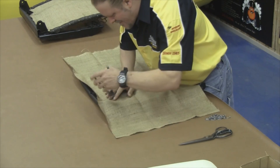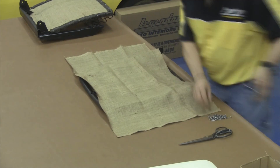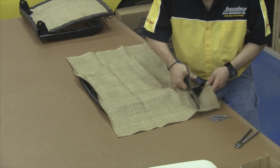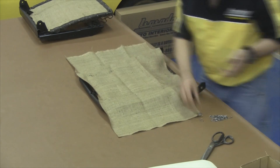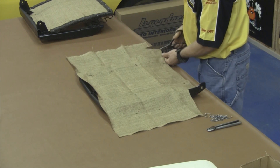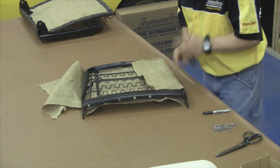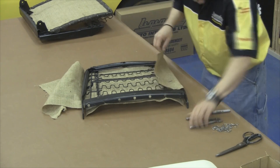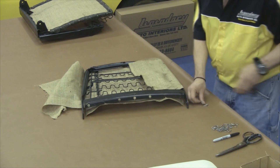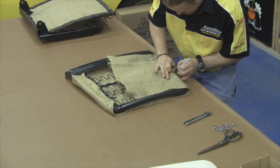Our next step, we'll move on to our front seat top. You need to attach the hog-rings through the burlap and around the seat springs. Start at the top of the front seat top and work your way down towards the bottom edge, keeping tension on the burlap as you pull it down. You'll want to notch out the hinge area again. Leave some extra material on the outside edges as that's going to fold over on the back side of the front seat top and attach to the back side of the seat springs. Carefully roll over the edge of the burlap and attach it around the burlap and around the rod that runs up and down the seat spring. Trim off the remaining excess and repeat the process on the opposite side.